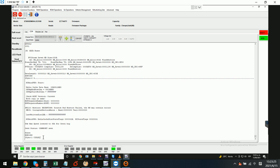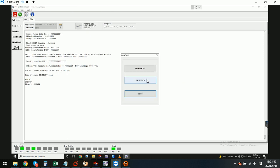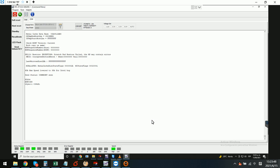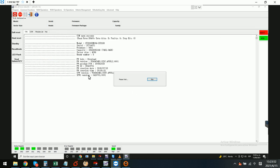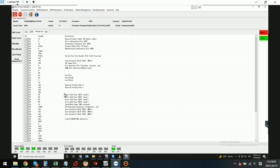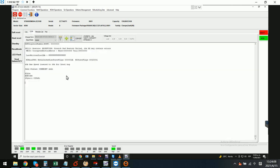After regenerating the translator, we power off and power on the drive to check its current status. Now they try to unlock the hard drive. We can see the drive gets ready after the translator regeneration. We exit and re-enter the program, select the family, click 'Obtain Details', and click OK. The 8TB drive is now properly detected and the module list is available after unlocking.